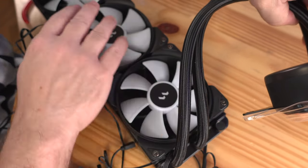Coming down to the bottom, everything is relatively nice and clean. The two extra PCIe 8-pins I rolled up nicely into the top 3.5-inch or 2.5-inch drive bays up here — in case I need them, they're easy to get to. I routed the PCIe 8-pins through the rubber grommet down here instead of going through the top, which made it look nicer. I didn't end up using the sag bracket because the card is vertical — it's not going to sag. I did use the Fractal Design piece and an extra standoff screw — it's the perfect height, just doesn't look perfect.